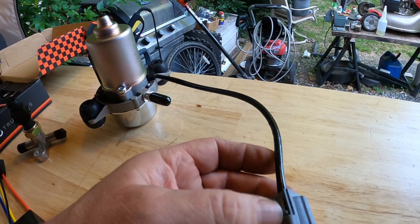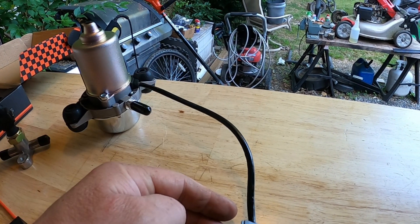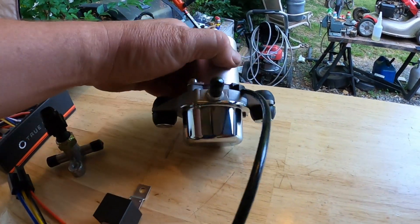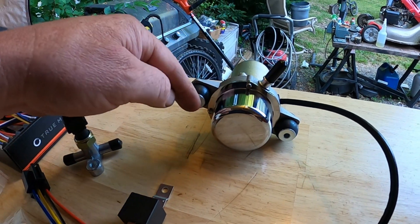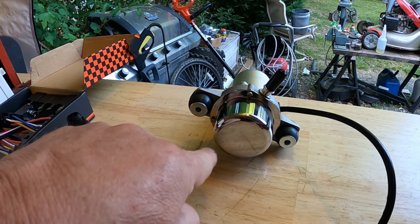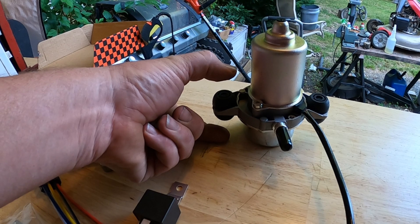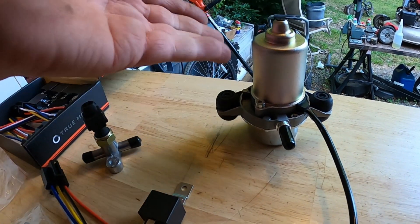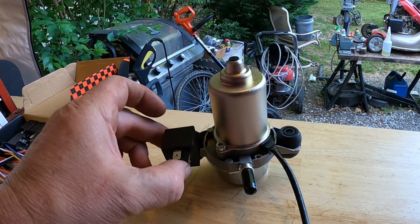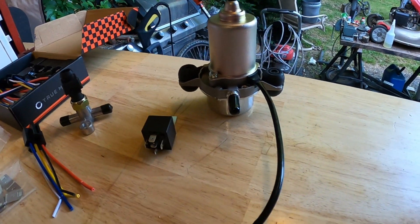This is 16-gauge wire. I already pulled this back and do not have another connector for this, so we're just going to lob that connector off. The only problem I see about this pump is that these don't extend to the bottom — I don't want to drill a hole that big in the guy's Galaxy. So I think what we're going to do is get some very long standoff bolts to stand it up off the inner fender well. I think I'm going to run the relay here.